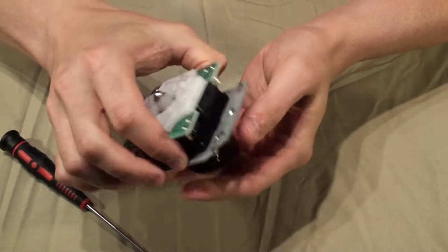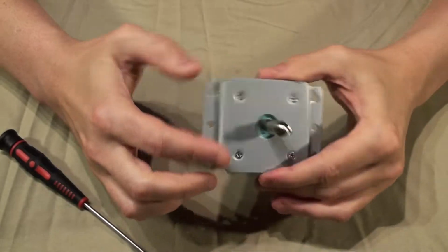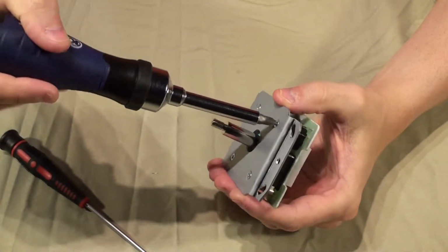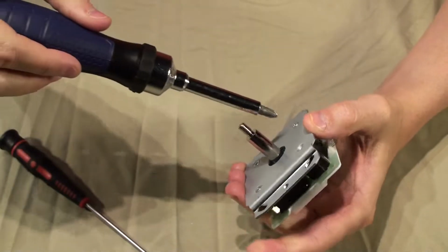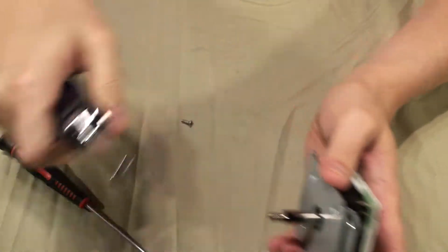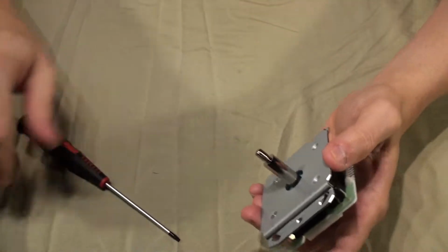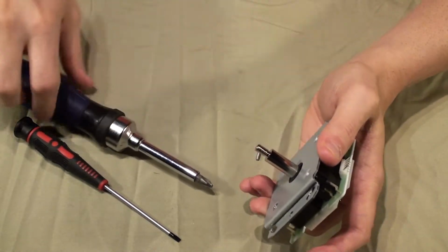Alright, from there we can tilt off and remove the dust washer, and after that where you go is up to you. I say we pull off the top plate first just to break this down. So all you need is a Phillips PH2, or PH1 can probably work. Remove these 4 screws, and I really recommend whenever you got little small parts going around, have a small cup available, because it really cuts down on losing parts. That's never fun.